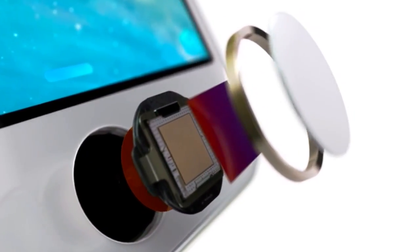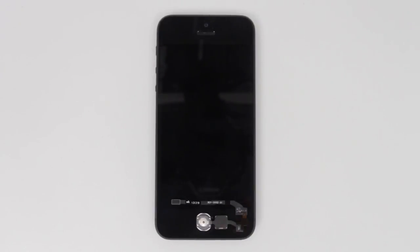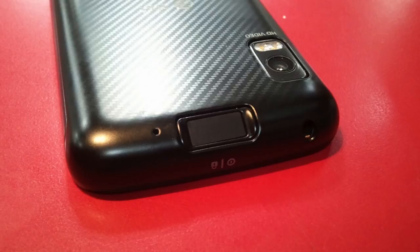Apple is using hardware to create these scans. The technological method employed is referred to as capacitance. This method varies greatly from traditional electro-optical scanners, which simply capture a black and white image of your finger and as such have been beatable using, in some cases, a photocopy of a person's print — helping to fool the scanner and grant access to someone you don't want to grant access to. You may have seen these old electro-optical scanners on laptops and even some devices in the past, like the Atrix.